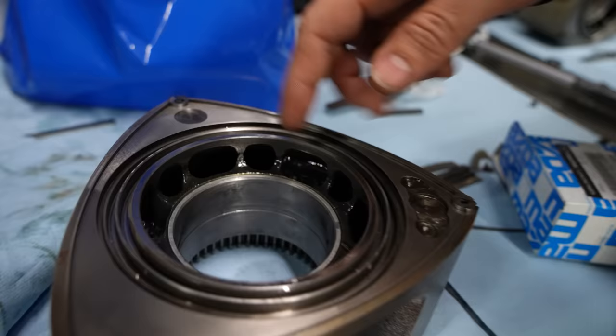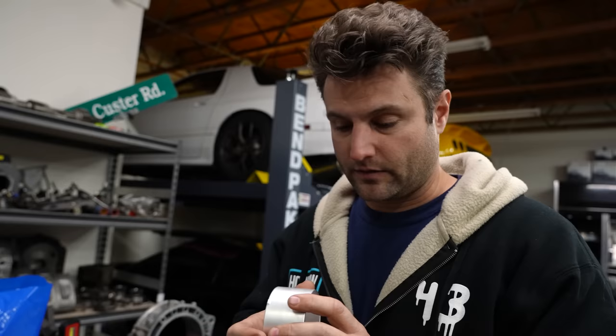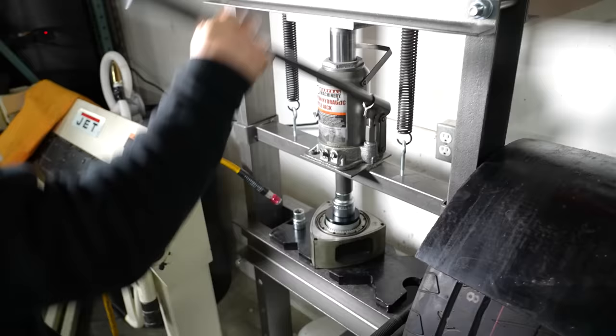We begin seeing wear on this motor, but we're using this motor differently than most people. So we're gonna go ahead and push these out, save them, and put these in. They should be slightly looser, and our goal is 4 thousandths of an inch of clearance, and that deeper groove will help with, I don't know if it's oil retention, I don't know exactly what, but you'll see when we tear this motor down again just what effect the race bearings have.